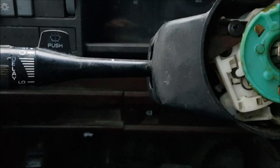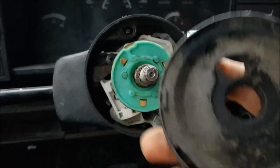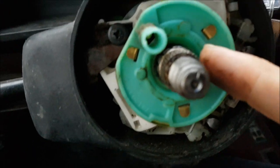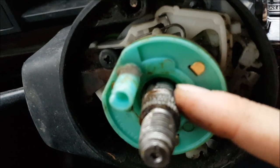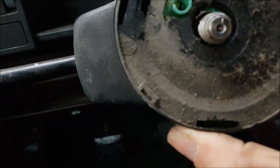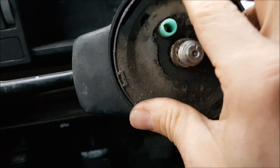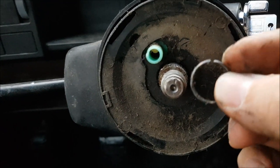And then on top of all of that goes your plate — this plate holds everything in place and it is indexed. There is a wide spot in the teeth — you can see them right there — there's a big gap. And on here there's that wide ridge right there. So we need to get that wide gap lined up — right there, that's where that goes. Now this is all held in place by a snap ring that slides all the way down into a groove here.